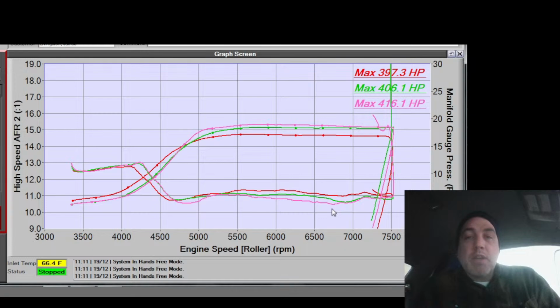I'm going to try it on this table right here. Let's find out. So I'm going to take this one, that one down to my idle speed, this one down to 200, and then right here, I'm going to go 160 degrees, like that. I'm going to do that on both my injection tables.